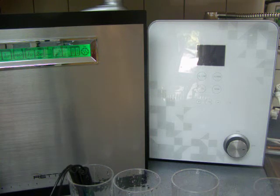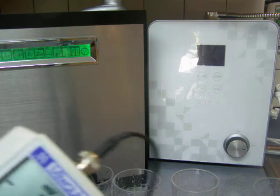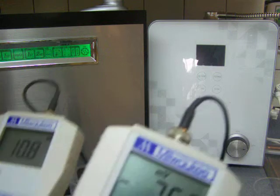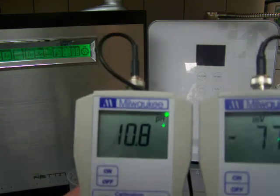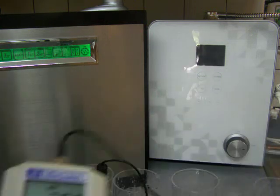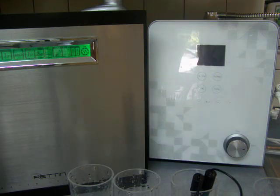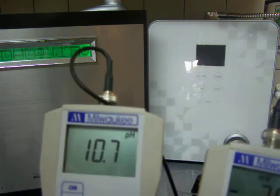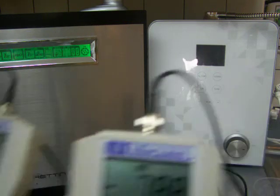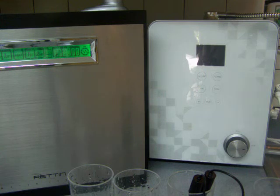This is the alkaline output, and we have to keep everything in perspective because we're looking at pH and ORP for both of these units. I may need to tweak the testing a bit — adjusting flow rate to try to get a similar pH and see what the ORP is at that point. The MMP-11 is showing 10.8 pH with a negative 780 ORP, which is truly fantastic. And the Smart is pretty close: 10.8 pH with a negative 786 ORP. So really, the Smart and the MMP-11 are not going to give you different quality drinking water — they're both going to be very similar.